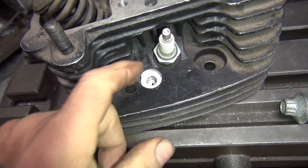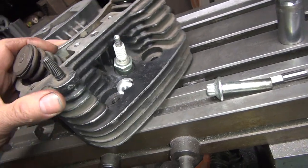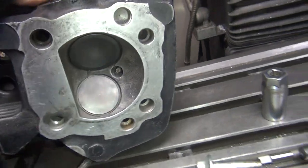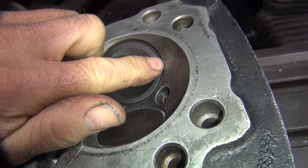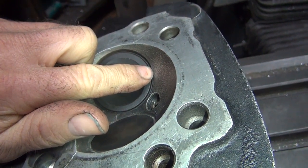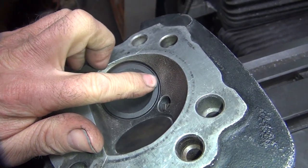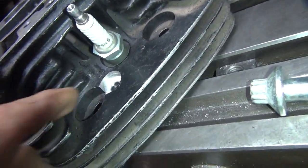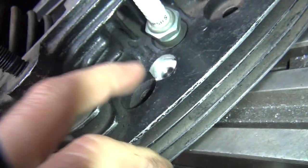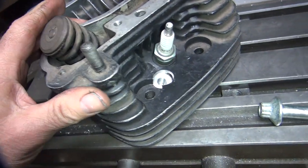So the question is: do I try to come in here sideways and hope I don't get the valve seat? It's really really close in there, and I bet the cutter is going to cut right into that area. You can see where the hole is right here — we know there's a hole underneath right where my finger is. If we move this cutter in at all it's going to be getting close to that seat and will definitely cut away the press fit. You can also see how much deeper this is here versus here — you're losing that step depth, which is almost 200 thou, and realistically we're only going to gain about that much coming up the top. So I think when you're all done it'll be almost the same depth, and you'll probably be into or right next to the valve seat, taking away some of the press fit.